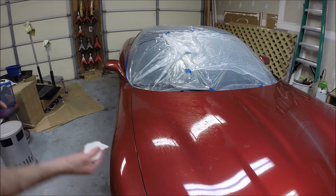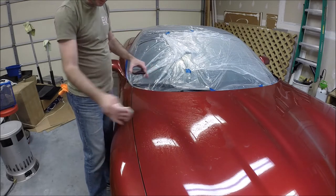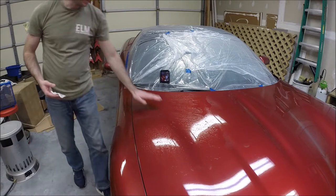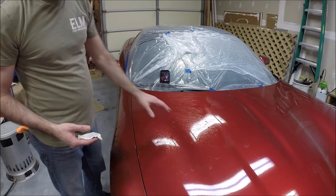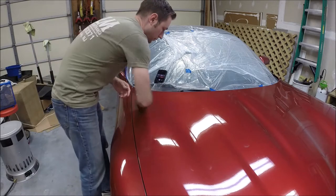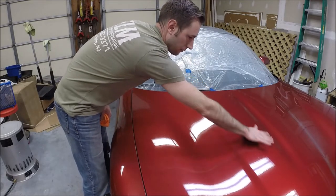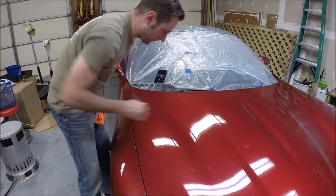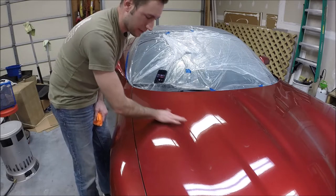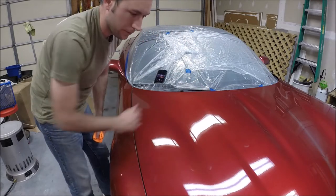You should do the whole car, but it's going to be the horizontal flat surfaces where anything falling would settle. You probably won't end up with a lot of debris on the sides of the car — the hood, deck lid, stuff like that is where you'll get the most benefit from the clay bar. And here's the best part: after you wipe down an area you just clay barred, feel an area you haven't done yet — it's clean but just a little rough. Then feel where you just clay barred — it's almost slick as glass. It's crazy the difference a clay bar makes on the paint.